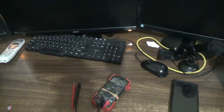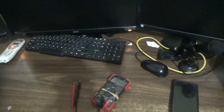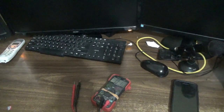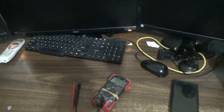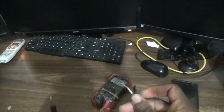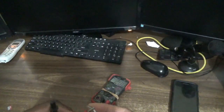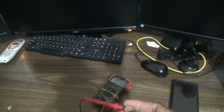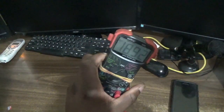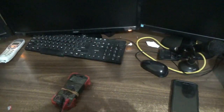I would have already pre-prepared this — I've removed the end from this donor charger. But just to show you that electricity is coming from it, I'm going to test it, ensuring that I'm getting 19 volts or around 18.7. As you can see: 18.92 volts. So I simply need to put the HP end on this one.